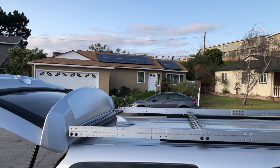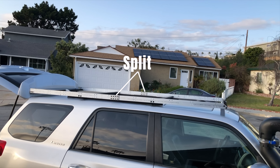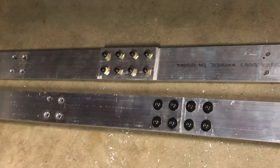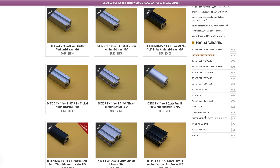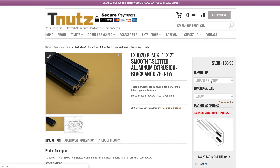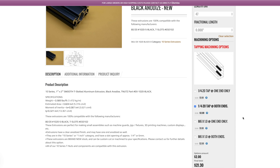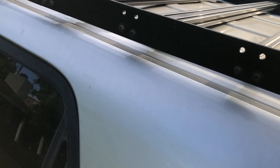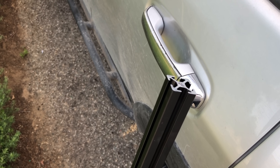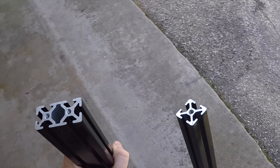For the sides, I'm using two-inch tall by quarter-inch thick aluminum. The total length is 92 inches, but I'm splitting it in half so it's easier to store and move. For the feet, I used three-inch by three-inch aluminum angle, quarter-inch thick, cut into three-inch sections. For the crossbars, I'm using extruded aluminum sometimes called 80-20 — it's available pre-cut, pre-tapped, and anodized in silver or black in a ton of shapes. There are loads of components that bolt right up to it, so you can build all sorts of stuff off your roof rack. I got one-inch tall by two-inch wide, black anodized, pre-cut to the length I wanted.